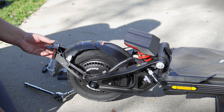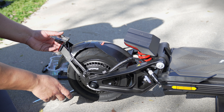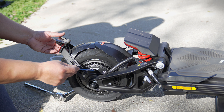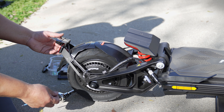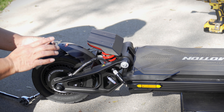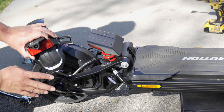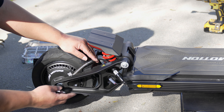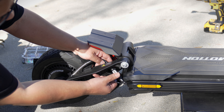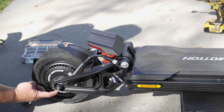Once you remove this part, normally it would be easy to come off, but because I have my dash cam installed I don't want to remove the zip ties. Just remove the screw from here so you can get access to the motor cable and the dash cam cable. Once you have the screw off, put the grommet and screw in a safe location where you won't lose them, then put the fender out of the way. Now we can go ahead and disconnect the motor cable.